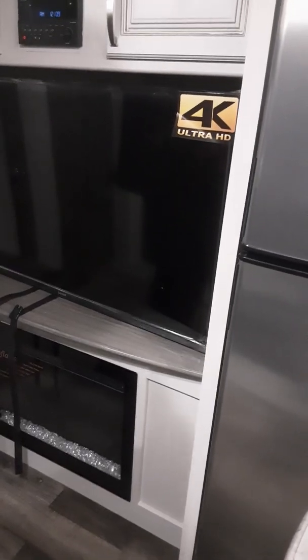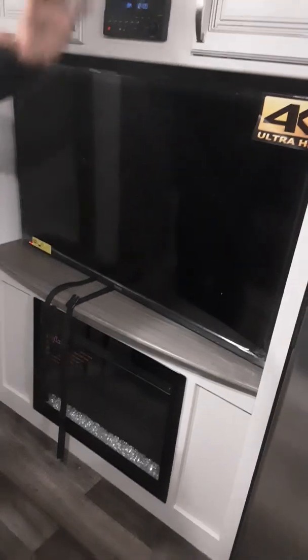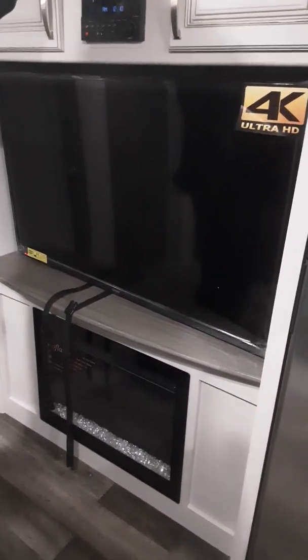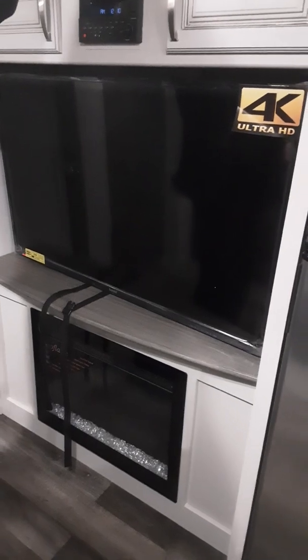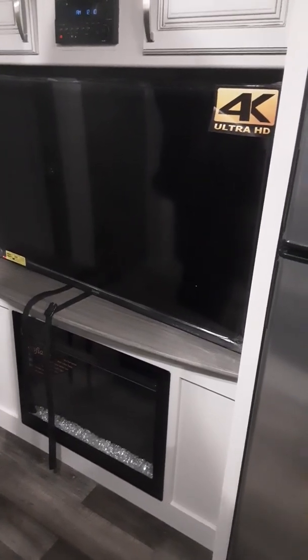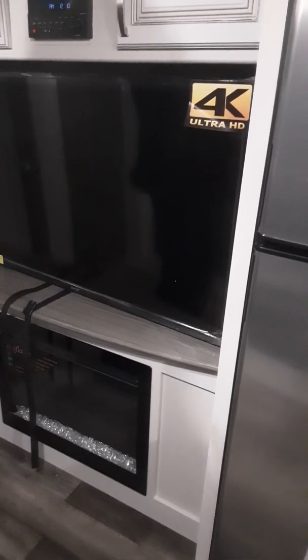So that's where you want to have a battery bank. There's a big black box out front with a red knob on it that turns on and off. That goes to your inverter. The other one is your battery disconnect, so that when you're not using your RV, you shut it off and the battery's not connected to anything. So you want to make sure they're both off.